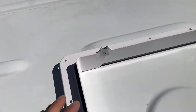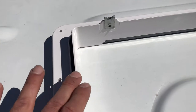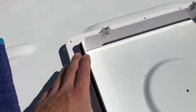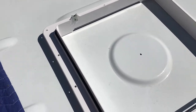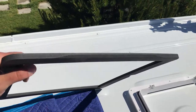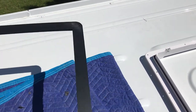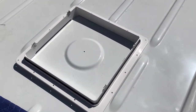The reason I went with the adapter is that this little rocker rocks back and forth because the ceiling or roof of the van isn't exactly flat or straight — there's actually nothing straight on this van. What the adapter does is accommodate the actual curved shape of the roof of the van, which is very slight, so on top it's perfectly flat. The flange will seat to the adapter perfectly, and the adapter will seat to the roof perfectly.